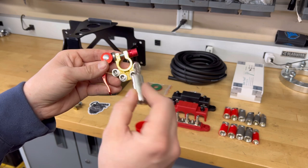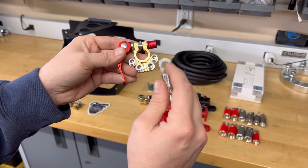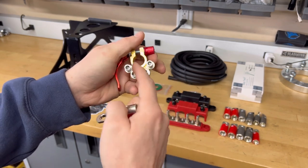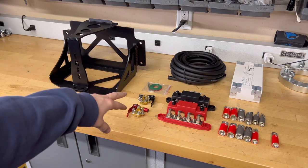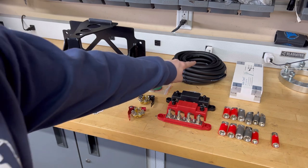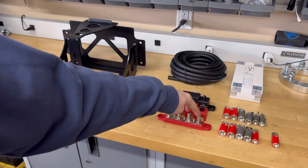A connector that I love to use with this kind of bracket is one of these. So you slide your line in there and you clamp down on it with an Allen wrench. Then you can install this onto this bracket like that and have a couple different one of those for your air ride or any of the other things that you have. On the back of the truck, we'll have this mounted and it'll have the battery on it with these connectors. And then I'm gonna run the Airlift three-piece system to this bracket right here. And then this line will be plugged in here and will go all the way to the power bank in the front of the truck, and all the things on the front of the truck will run into this.